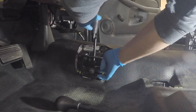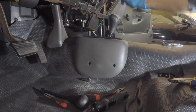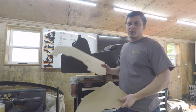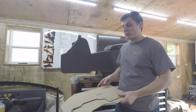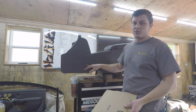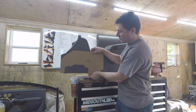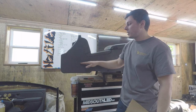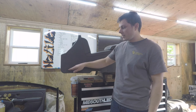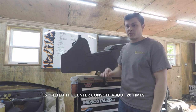Get the new one in the same way — turn, rotate it down in, and then rotate it straight. Slide it in and then slide our pin up in there. Now put our new cotter key in. If you're wondering about this cover, you do not have to put the cover on first — you can put the shifter arm on and then this gap right here you can just lightly squeeze it apart, pry it a little bit, and it slides right over the top of that knob. Next part is probably going to be the hardest part of the entire swap — we are going to be notching our center console out. We're going to have to make a bunch of templates, and always remember: measure twice, cut once. I cannot stress that enough — if you cut this too big or too far out you're going to mess your center console up and it'll be ruined. I actually made two templates; one was too small, so make sure every time you use your template you have the same reference points — always flat on the bottom, flat on the sides.